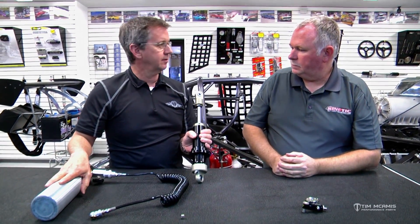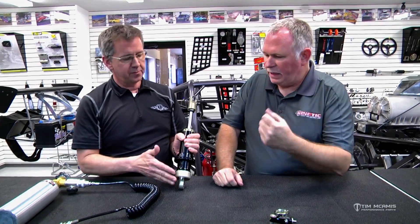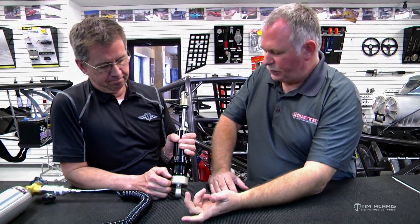So let's say I'm at the track, I check my pressure and it's down, and my nitrogen cylinder is empty — can I use compressed air to get by for the weekend? You could top it off with compressed air because you're not filling a complete volume, and most of us have a drying-type system, either a coalescent filter or something, to keep from pumping water in there. So it would be better than not doing anything. If you're at 25 PSI and your nitrogen bottle's empty and nobody has any, hit it with compressed air, bleed it back down to your number. Then when you get home, take the Schrader out — same as you would from your slicks — pump some nitrogen in, and let it blow back out. That basically purges it. Then put the Schrader back in and pump it up with nitrogen.